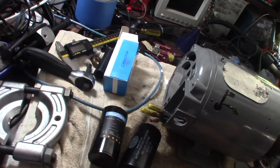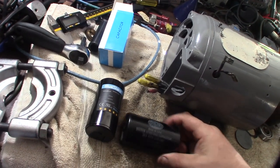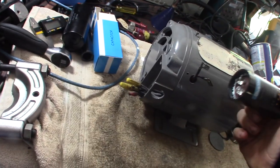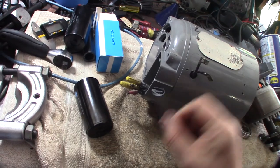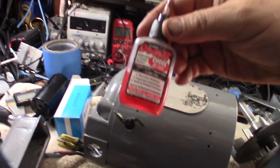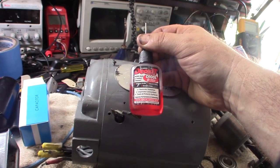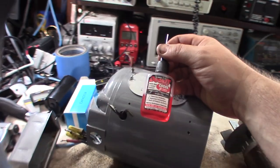The Amazon replacement capacitor — obviously it's made in China, it's less than $10. It's not polarity specific because it's AC. If you saw a DC cap you'd see a positive and a negative. Those contacts don't look great and they don't sit tight on there, so I'm just going to clamp them down a little bit and put a little Deoxit on them — that will actually clean the contacts, or at least clean the oxidation off. I use this stuff on a lot of my videos — it's incredible. It's like $26 for a little bottle but there's nothing better for cleaning oxidized contacts. It fixed contacts on mouse buttons and everything you can think of. I'll put a link down below.